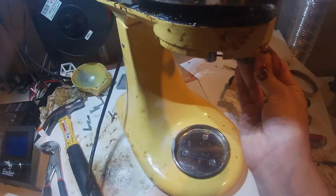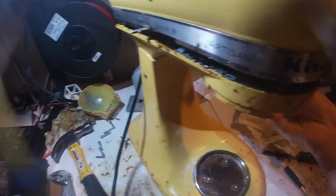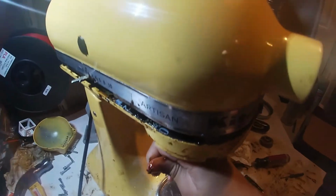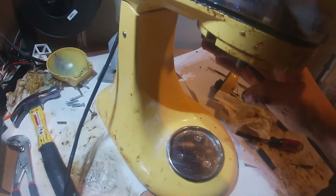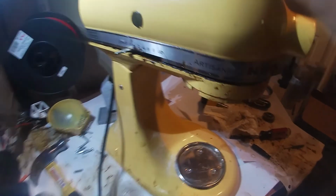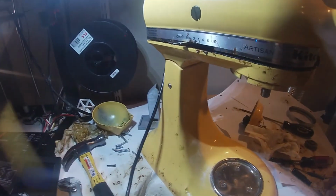Okay, so when you put the lid on top, you'll notice that it doesn't fit in. You'll want to put a punch tool through there, and then keep rotating it until it sinks in. That's because the gears are not lined up. So don't force it, just rotate it until it fits. You can't do this with one hand. There. So you'll see, now it's pushed down. It's not going to be fully flush, but as long as it's around this, it's fine. Then you're just going to want to put in the screws, undo the steps you did while disassembling it, and then test it.